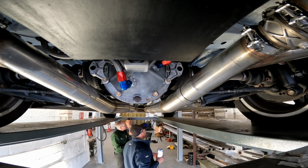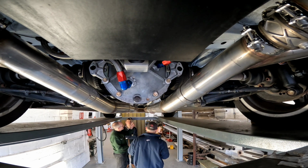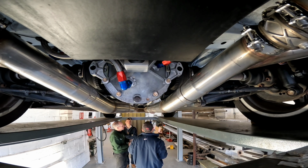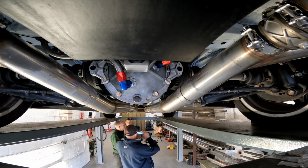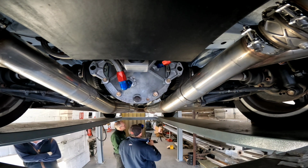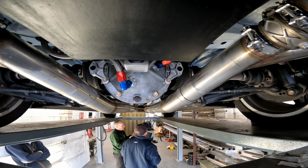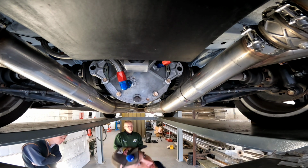Well, I think the other big thing for high speeds, which is probably a positive from a Lotus point of view, is that they have the steering box instead of a steering rack. At high speeds, that tends to self-centre itself as the car's relatively stable anyway. So you haven't got any micro adjustment going on, because the steering by design is quite vague. No, I'm doing that because it's got uprated springs and shocks on it.